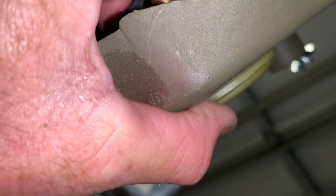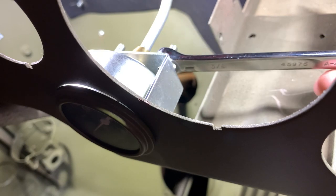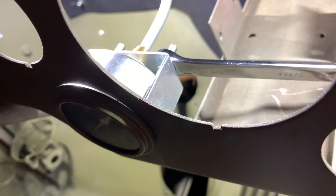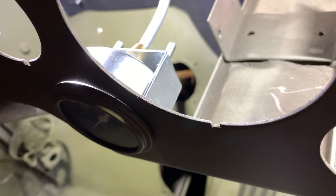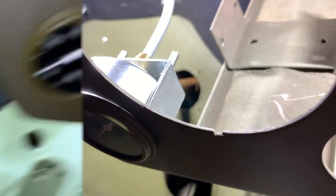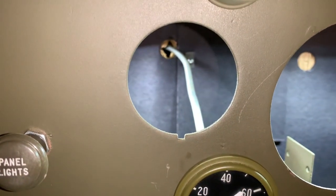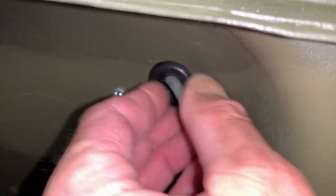I've repositioned myself here. I'm showing you how that little nipple or indent on the outside of that casing goes right into the dash, and now we're inside here. We're going to slip our bracket back over those two studs, and then we can reinstall the lock washer and the small nut there with a 3/8 inch wrench. I'd like to get some of these gauges in before I continue on with the wiring series, just because I want to have these in so I can route the wires around them. We'll take a look on the outside — all tightened up and everything's secure — and we can look inside the dash and see how that metal line goes from the gauge through the firewall pad and through the firewall.